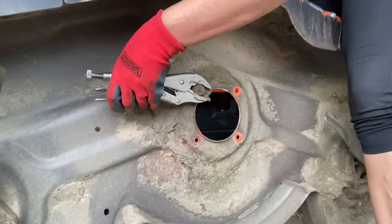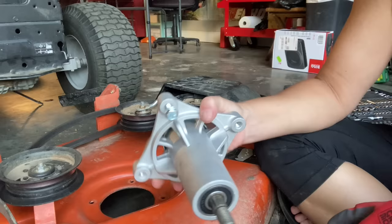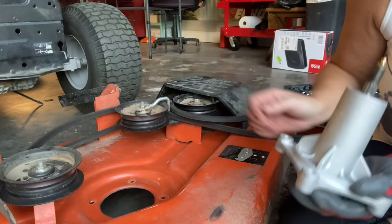Since there was a piece that was left of the spindle in one of the bolts, I still have to remove the bolt from the other side. But I have to have a way to keep it tight while I'm doing it, so I use my vice grips here to hold it while I get it off. Now, depending on where you get your spindle from, I get them already pre-tapped with all the hardware because my customers like it best that way — they don't want to have to tap it. But you might get one that does not come pre-tapped, and you'll have to do it yourself.